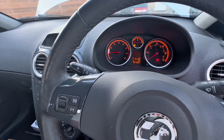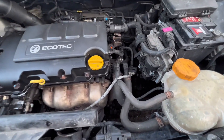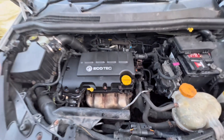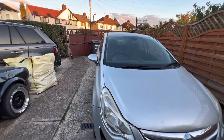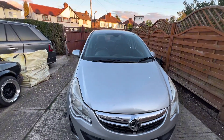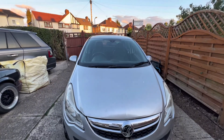Hear it purr! As you can see there's no shake on the engine whatsoever, and the engine sounds a lot more healthier than before. Guys, that's how you get rid of your P0171 code just by checking that PCV — it's made a huge difference. I hope you enjoyed the episode, don't forget to like, subscribe and share. We'll see you in the next one, take care.